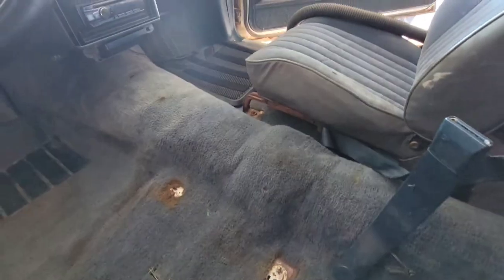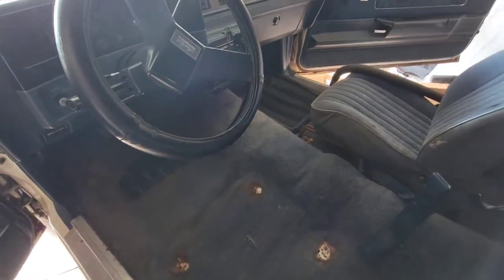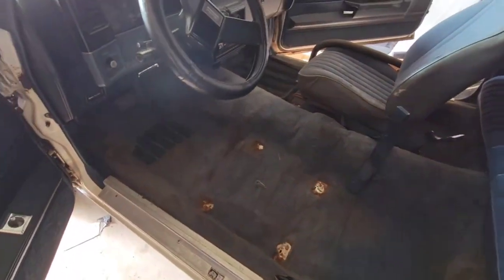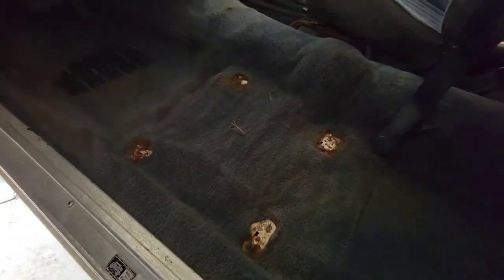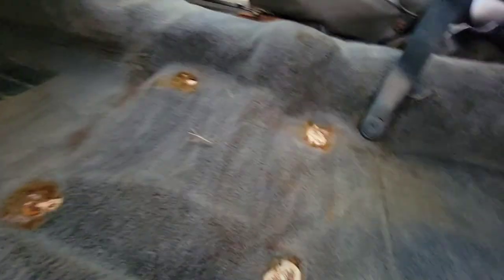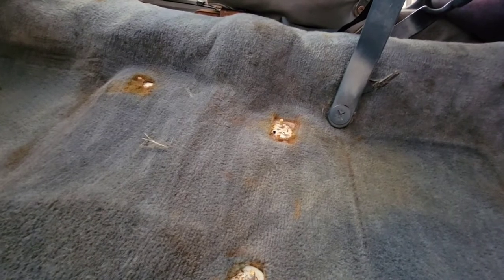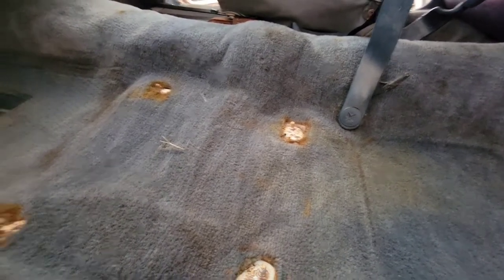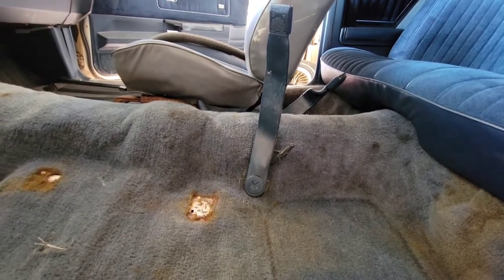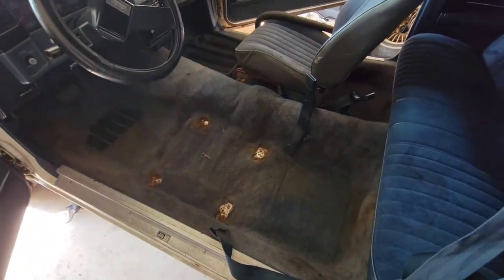We got the center console also. While the carpet is up, we're going to go ahead and tack weld those little brackets that the center console bolts to, and the one the floor shifter bolts to. But this is just a mock-up video, just to give some content. You've got 13 millimeter nuts with covers on the front and back, a Phillips head screw — undo that, remove the nuts, and the seat comes out. We're also going to remove the middle passenger seat belt.